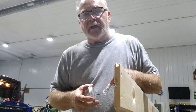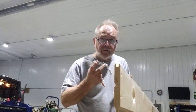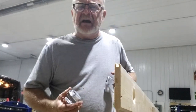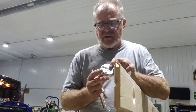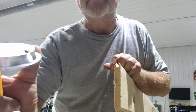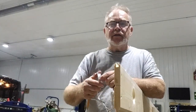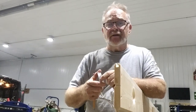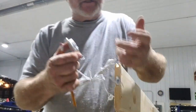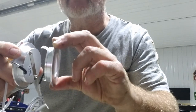An interesting thing that came up with these lights and installing them: the bracket at the back is meant to push into very thin plastic in these RVs. The problem is the regular hole saws don't work - we've got like two sets and we couldn't get anything that in a hard surface would push in with it in that configuration.